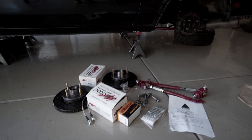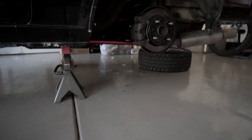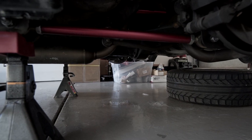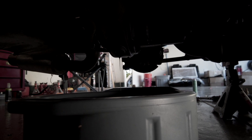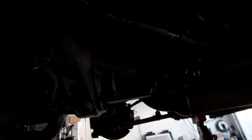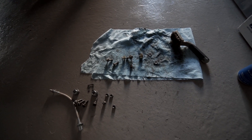To keep things productive I'm going to move along and drain the rear diff. As you can see on the floor, there's definitely a leak somewhere. The diff is now draining. I also started unbolting the drive shaft from the differential and the rear brake line as well — once the time comes to drop the rear end, there'll be a couple fewer things to do. More cleaning of fasteners.